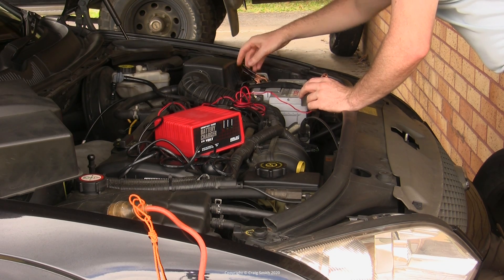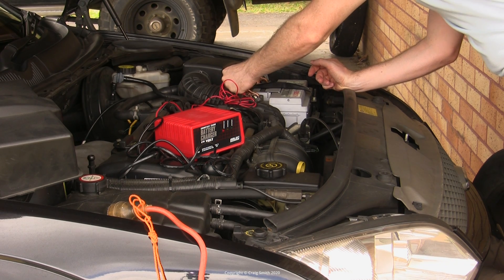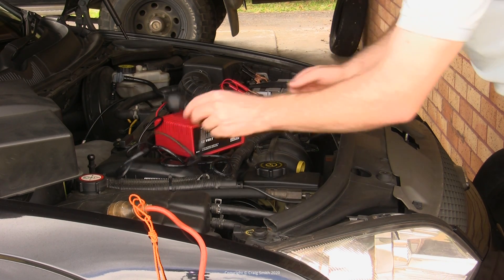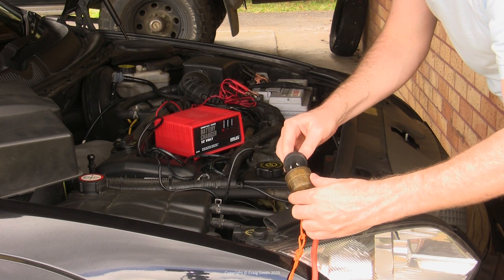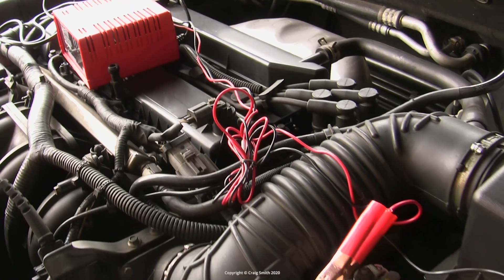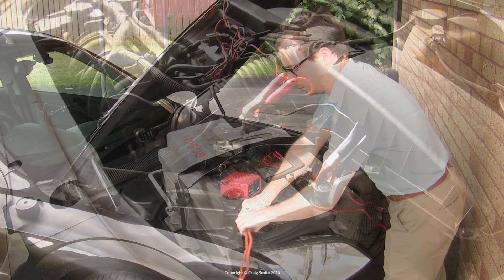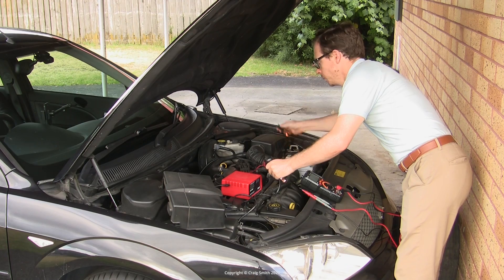You could use a mains charger — that's what I'm doing here — and I also had to jump start this car a few times when I was out. If you do that you will have to drive the car for some time before the engine has time to recharge the battery, so using a charger like this is more reliable. If you give it a full charge or use a decent smart charger and let it go through all its cycles, this process alone might coax a bit more life out of the battery — if it needs desulfating or such like — but if something else is wrong then this is not going to fix it.